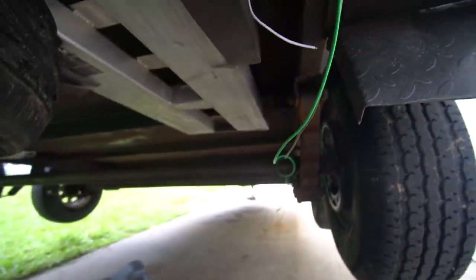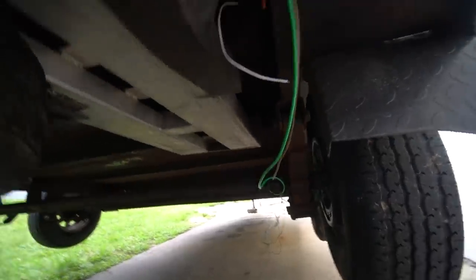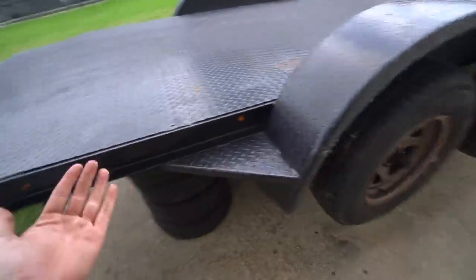So basically I gotta drill holes and put a P-clamp there. I had to drill a hole through the seal and then P-clamp it with a self-tapper. And the spots where I can't get a P-clamp, I'm putting some tape to keep it nice and tight and out of the way. So it's just a little time consuming. I'm just gonna keep working my way down and try to keep it as secure as possible. I think I'm gonna go ahead and do my wiring for this so then I can secure it all at the same time on this side.